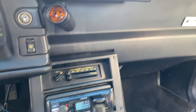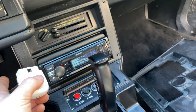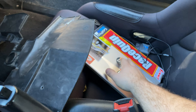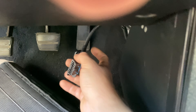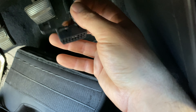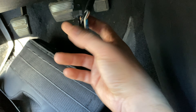My interior is in shambles — I'm trying to figure out why I can't get anything to connect to the car. I'm trying to use this Autel scanner — Autel sent me this Bluetooth dongle and you use an app on your phone for live data. I was going to monitor RPM and set the shift light, but I can't get it to connect Bluetooth-wise. My HP Tuners dongle doesn't connect either, so I have a feeling it's a problem with the OBD connector. Looking at it now, the pins in here are very very loose — not making a good connection. I tried bending them down to make them tighter, but one actually popped out and the plastic clip retainer that holds the pin in is completely broken. I ordered a replacement connector coming tomorrow.